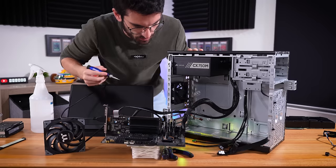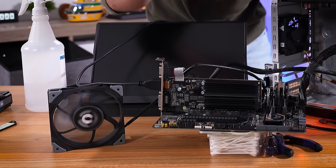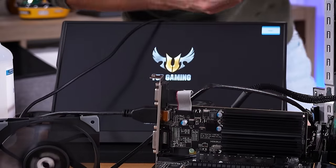The CPU also doesn't have a cooler attached — we're not going to leave it on long enough for that to matter. But don't try this at home if you're not very familiar with tech. Here we go — power on. The board is lit, that's a good sign. Let's jump the power pins. Is it really powering on? It is. We might even get a post here. Wow, we did. We got a post.